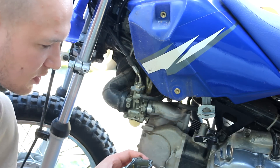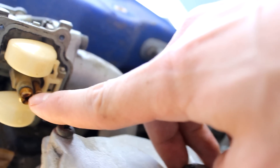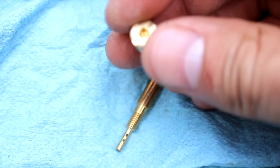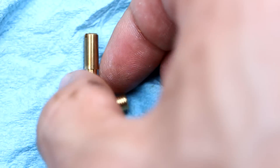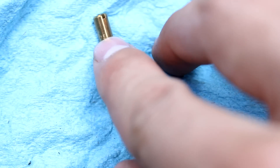This is full of gas here, and it's going to be hard to see because it's underneath. There you can see the pilot jet and the main jet — we're going to be unscrewing those with a flathead. Here are the new jets we're putting in. This is the main jet — it's a 95. This is the pilot jet — this one's a 15. It'll actually say it printed there; that says 15.